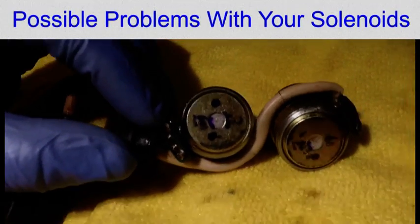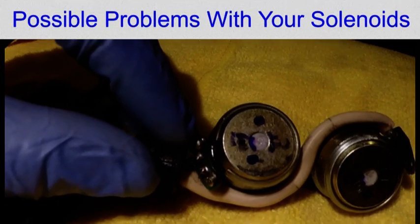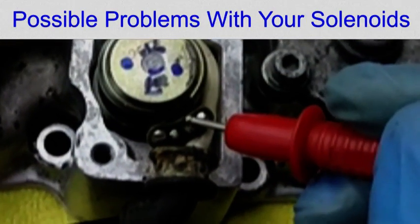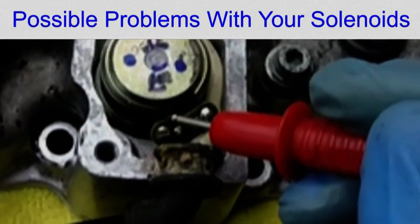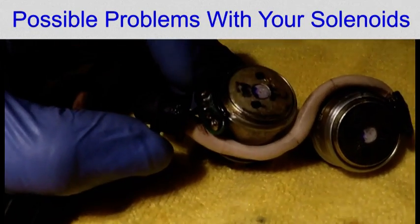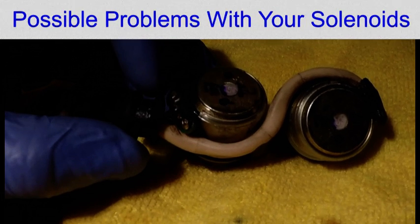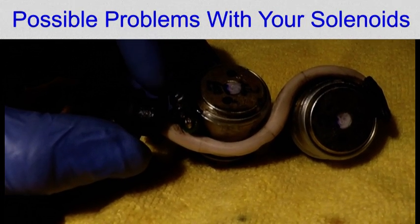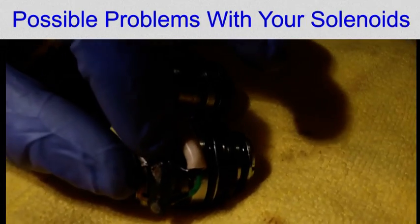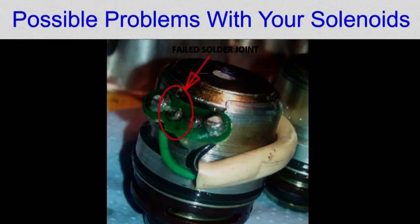Other problems you may encounter on the solenoid: this circuit board can become loose. You can see that it wobbles. What I shall do is drop in some epoxy into there. I've repaired mine with epoxy resin. You can also put the epoxy resin over the top of the contacts to avoid the contacts touching the body of the vanos and causing any short circuits. The electrical contact soldering in here can also fail.